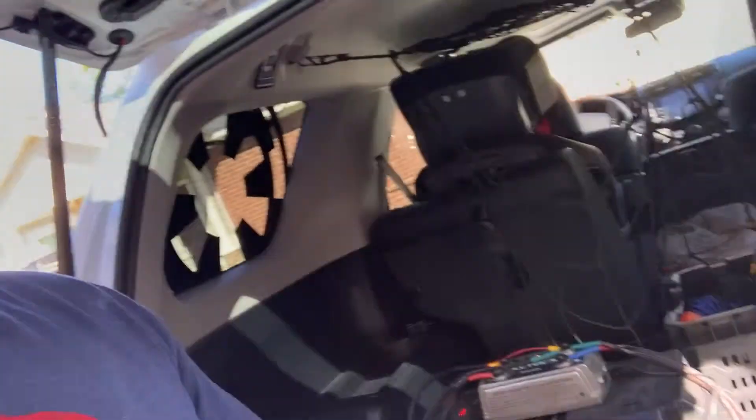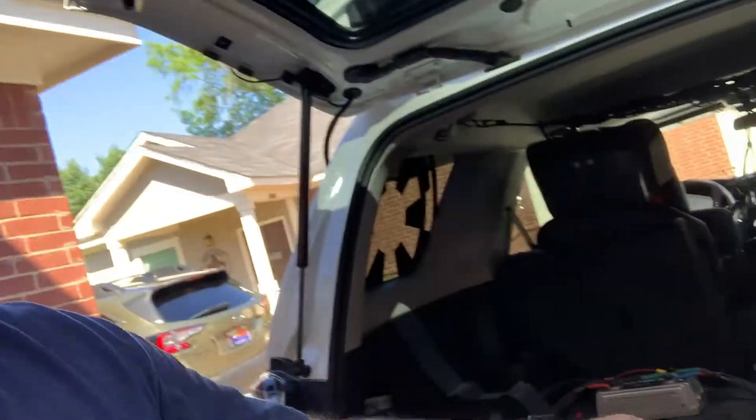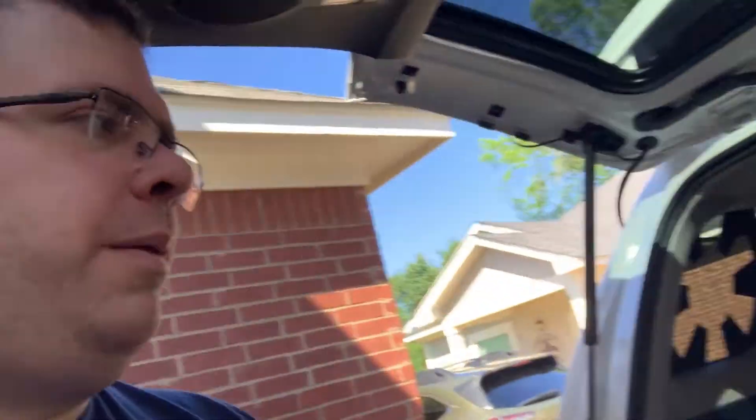While connected to solar, if this battery is topped off, it'll actually flip the relay and start charging your cranking battery. Right now it'll be topping off my cranking battery. So not only will this keep me from getting stranded, adding the solar will even charge up the battery that cranks my vehicle. Yes, it's a little wiry — you've got wires everywhere — but I made it modular because I used to carry it between my vehicle and my wife's, and I still like to set it on a picnic table or give it to a friend. It makes it really simple and portable.